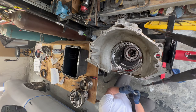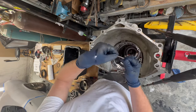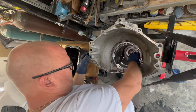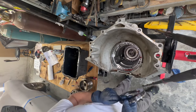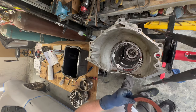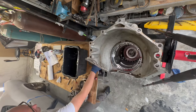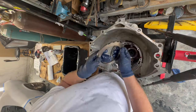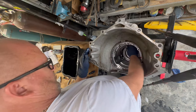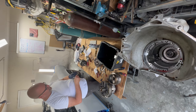This bolt is a three-eighths 12-point. Now we're going to put this beveled snap ring right here — it's got a little bevel on it. The bevel goes down, so the high part faces the outside of the transmission. Now we put in what I think are the intermediate clutches. We get this snap ring that kind of goes in down here. These were already soaked. We try to line these up and put in this big plate here — pretty straightforward, only fits in one way — and then put in the other snap ring.